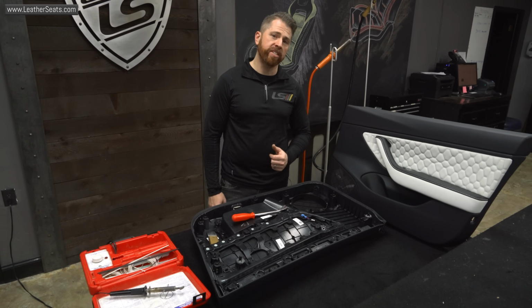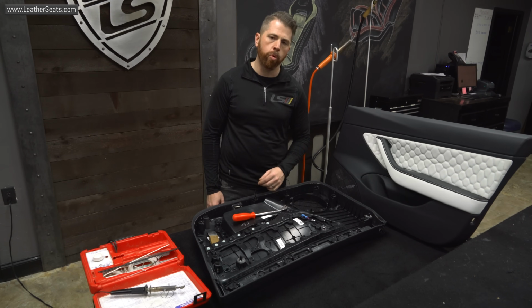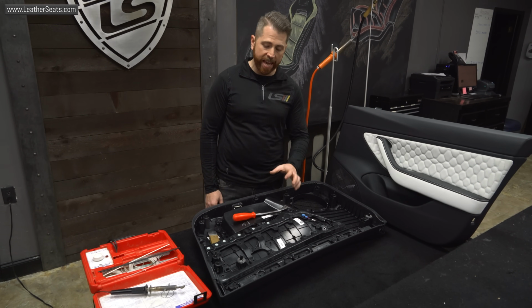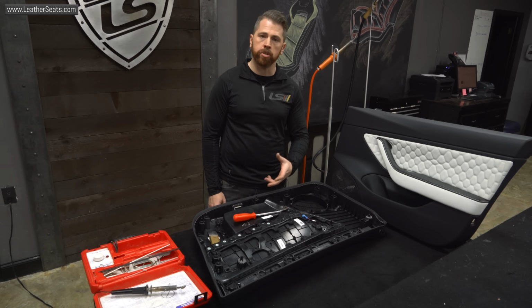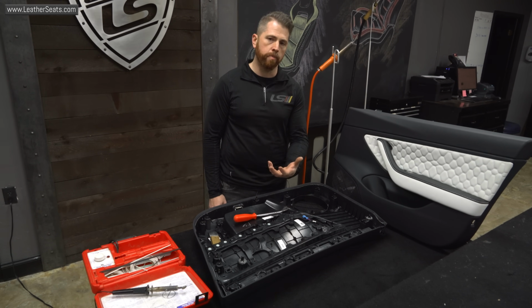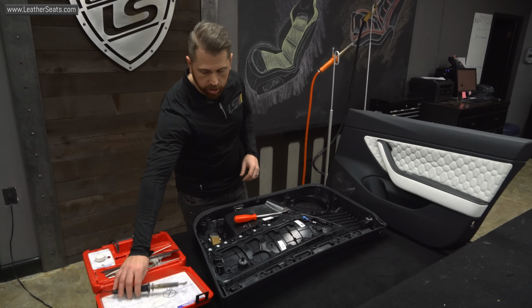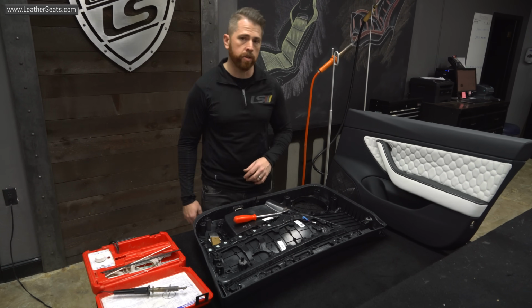All right, so that's the plastic welding method. I used the air torch to work each of these 3 attachment points back into a rough cylinder shape, and if I did that 37 times, I'd be able to get both components out of the door panel. From there, I could wrap them, stick them back in the door panel, and I'd be welding them back in using a traditional plastic welding iron at all 37 of those points.